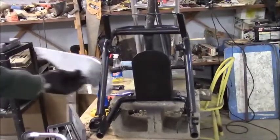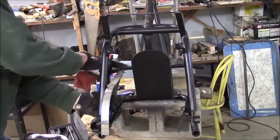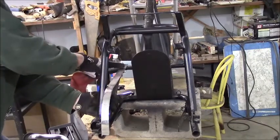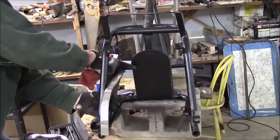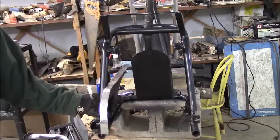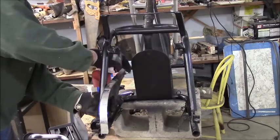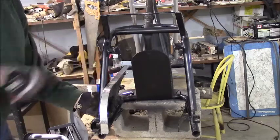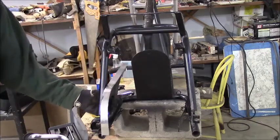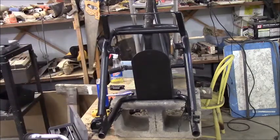this will be positioned in here. So if I just take a tab and come out, I'll heat it and twist it, or maybe I'll just weld it straight, and now the fender will be in there. I'll put it in front of the fender. It'll be the last thing I do here while I see what I got anyway. So that'll be in there somewhere. I could probably just, it actually touches the fender. I could just put a little tab between the fender and the chain guard, because that will keep that from flopping. Yeah, the chrome on this isn't all that good anyway.